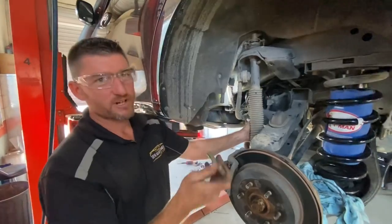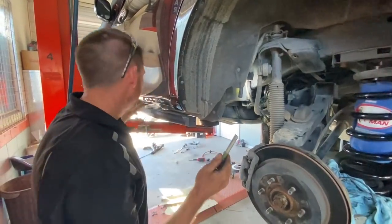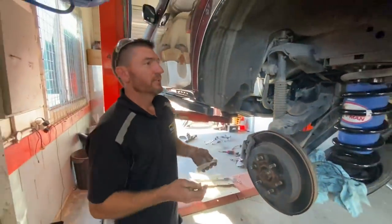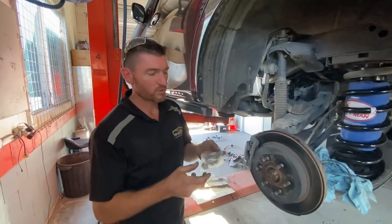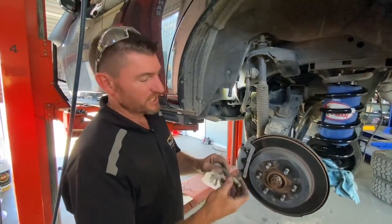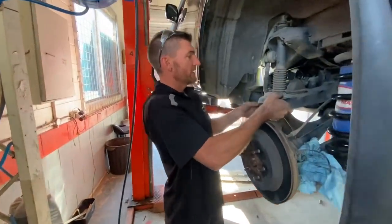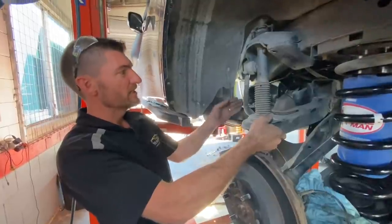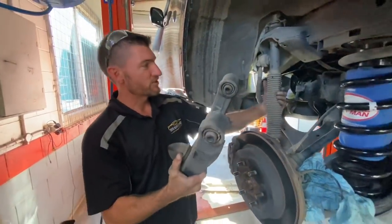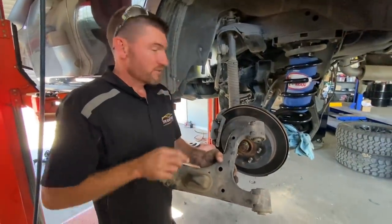It's easy to drop the K-frame, but we don't want to do that. We order a genuine replacement bolt - I'll put the part number on screen. These cars are towing heavy vehicles, so the last thing you want is a bolt that wears out or fails. Turning it around is not an issue - the locator on the bolt sits in nice and it's perfect. Once you've got to this stage you can get that arm out. Move the lower shock section out of the way for a bit more play, and the bolt up top - no fighting, no struggling, no damage.